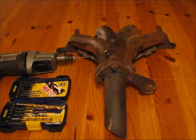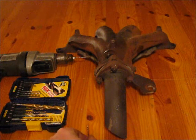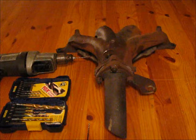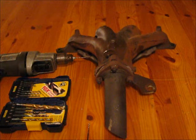After you've got your hole punched, the next step is to drill through the top of the old bolt. We're going to be starting off with a pretty small diameter drill bit, but not small enough to snap. You're going to start off with a small one, and once you penetrate the bolt, you're going to increase the size of the drill bit until you drill out all of the old threads for the old bolt.